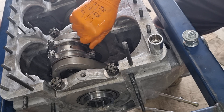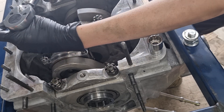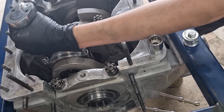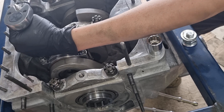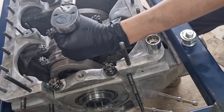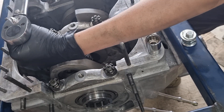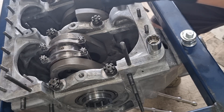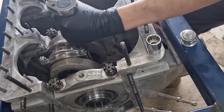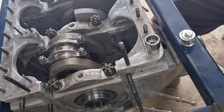I always do these ones up diagonally. We're not doing the final torque yet — we just do it until we can feel about 20 foot-pounds. You'll see Peter wiggles it every time I finish a fastener. We get a little bit of floatiness — perfect.